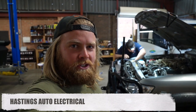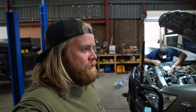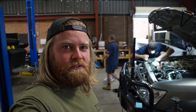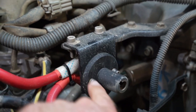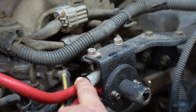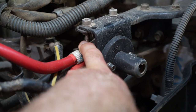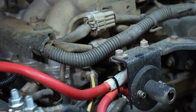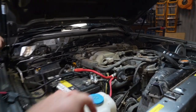Back down here at Hastings Auto Electrical to finish off this front end build. With the bull bar and winch we were sort of able to do it ourselves, but with all this wiring stuff I figured I'd leave it to the professionals rather than me trying to set the car on fire somehow. Got them to check over all the other work we've done too. One thing the guys here already fixed up was this isolator switch for the winch — that bolt was sort of touching and that's a very big fire hazard. So they just zip tied that down so it's not touching the bolt and put a bit of protective sleeve over that. They put a shorter bolt in just to give a bit more distance there.